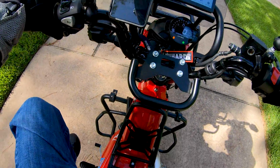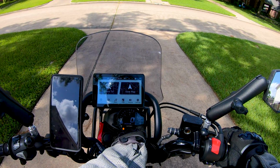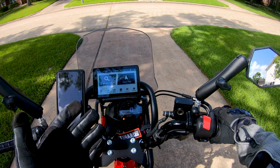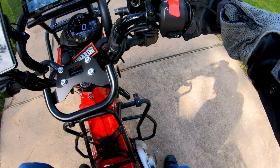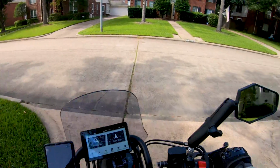Okay, so here we go. The temp warning hasn't gone off yet, but it's about to. You can see the temperature rising pretty quickly here. 76 Celsius. It gets right up to about, I think it's 85, 89, somewhere up near what would be water boiling point, and it starts freaking out. But of course, this is an air oil-cooled motor. It's not going to be boiling off any water unless you splash through some.